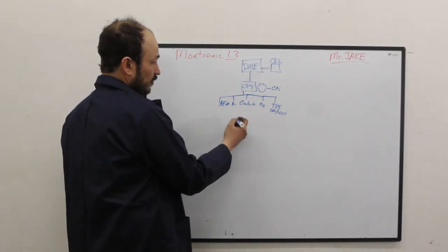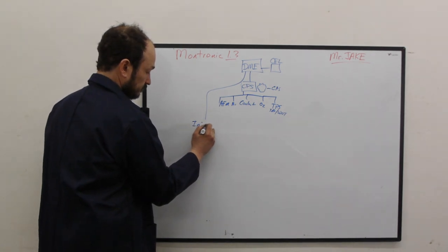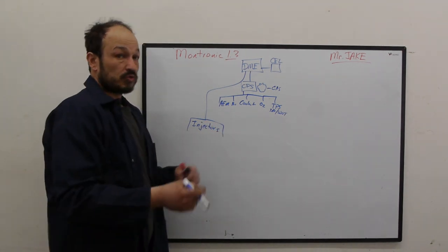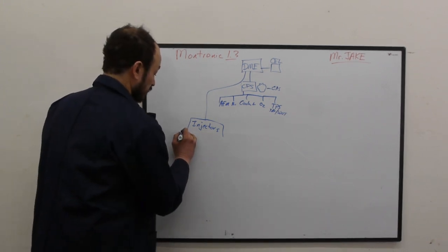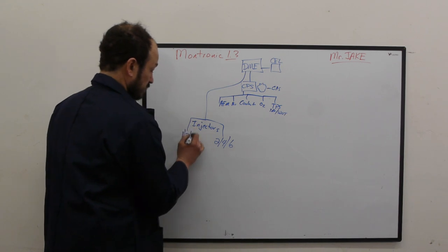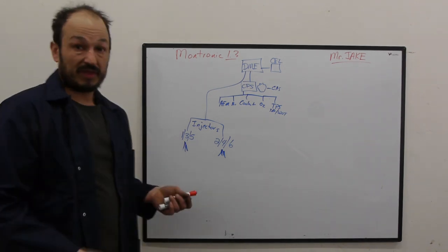So from the DME, then we have our injectors. We have two banks of injectors. The earlier cars are 1, 2, 3, 4, 5, 6, and the later ones are 1, 3, 5, 2, 4, 6. In this case, bank one is 1, 3, and 5, and then we have 2, 4, and 6. It's pulsing these injectors, spraying the fuel into the engine, and letting the thing run.